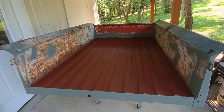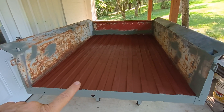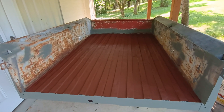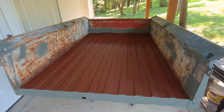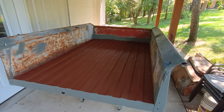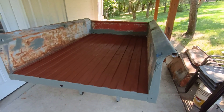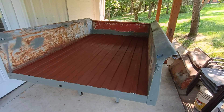We're all done. I shot the bed — actually painted the bed with a brush — but I put some Rust-Oleum red oxide primer down. That'll hold up really well while I wait for doing the bed liner. Bed liner isn't going to happen until the very end after it's all been painted — then I can just easily mask it off and shoot it with paint. I've put a little bit of primer around all the bare metal just to hold it until we're ready to finish up body work and go to paint.